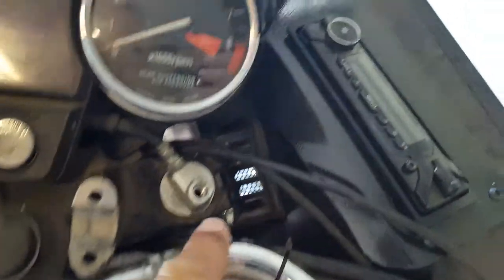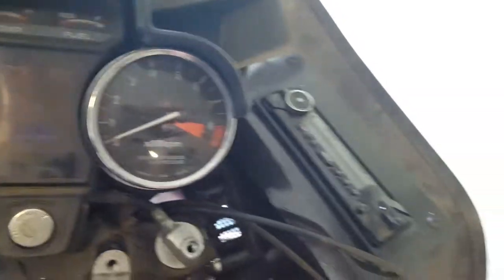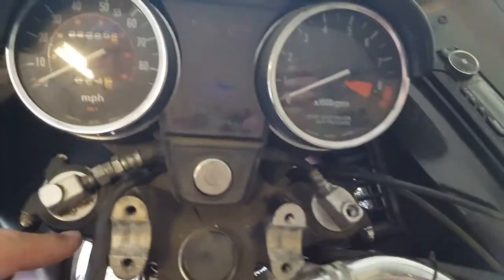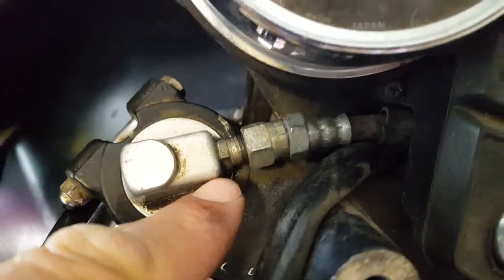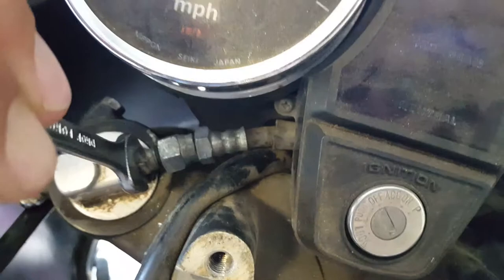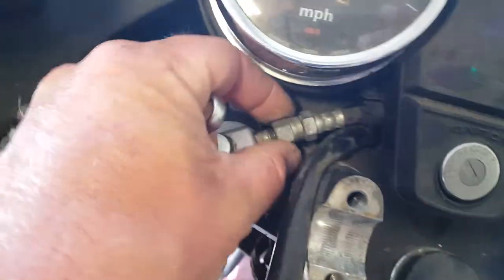As you can see, I've taken off the air hose and bled out all the air. Didn't get any oil because that side's dry. These are the two nuts I was talking about — you just got to hold this one with a T-handle, I think that's a 10, hold that one and then loosen this one off, otherwise the hose is not going to let you twist.